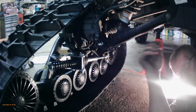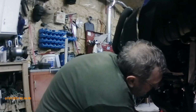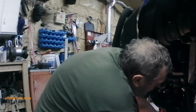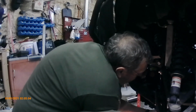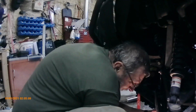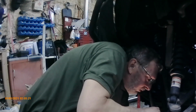So that part is all finished, so your truck is on. Now the first thing you've got to do is take these protectors off the front. That's for your universal boots, CV joint. So it's just two 6mm bolts, 10mm head. And of course we're going to save everything.